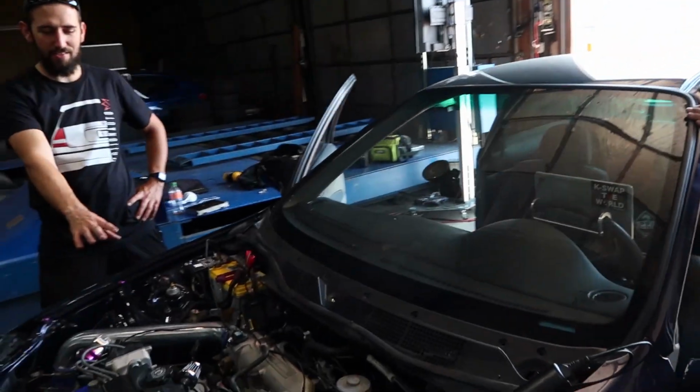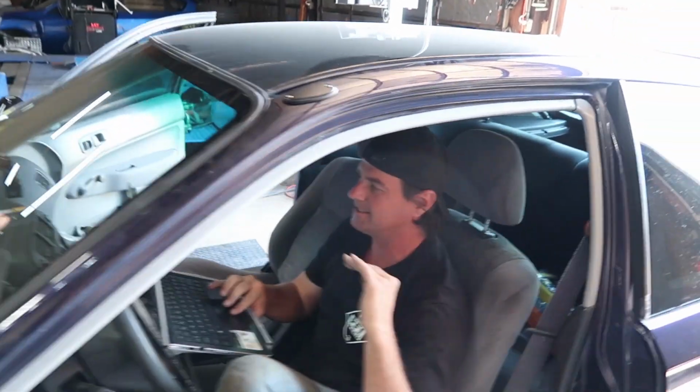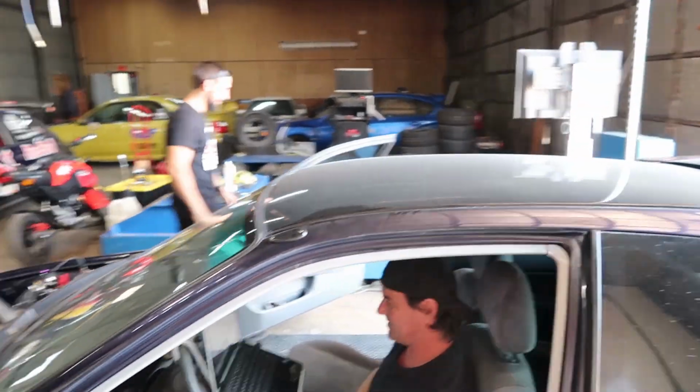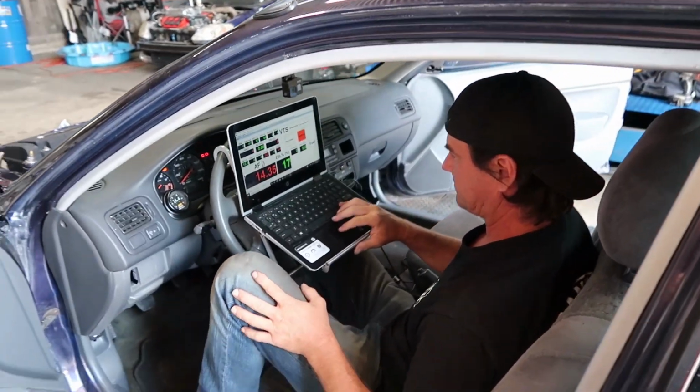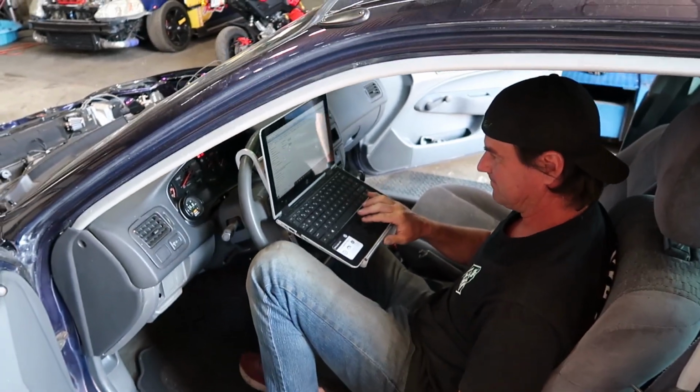I plugged it in. I left the harness on it. That's why it stayed at 177 too, the temperature, because that's the ground spot. That's what VTEC is. Hey, now it's 97 degrees. Oh man. So your fan's fine, you know. That saves me from chasing it down.